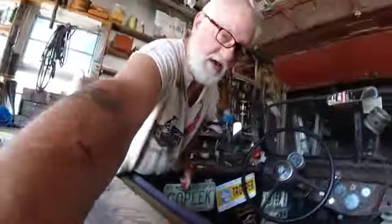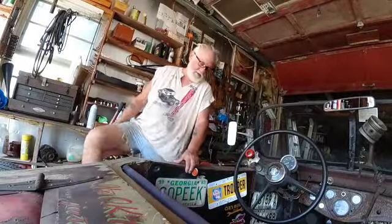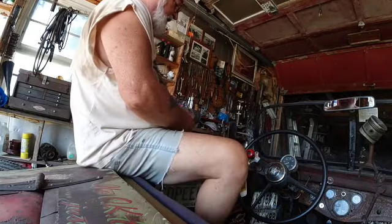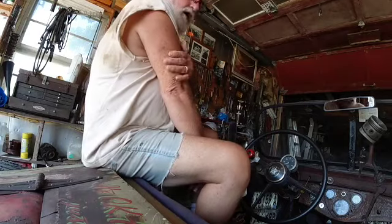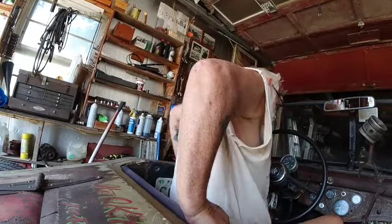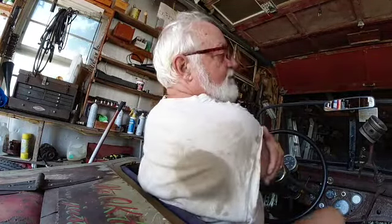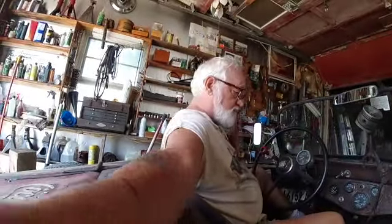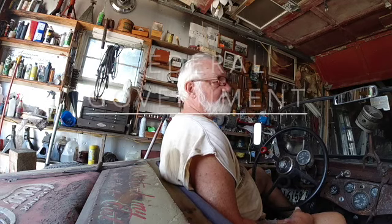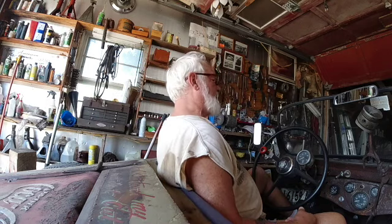Back in the 70s, they decided that we were all going to run out of gas, and they needed to figure out a way to slow us down, because in the age of muscle cars, moms were driving to the grocery store in GTXs and RTs and Camaros and all that. I think they thought if they made the cars where they wouldn't run fast, people wouldn't drive them as much, so it wouldn't be any fun. And there's a lot of truth in that. So what they did was they cupped out the pistons, chopped the compression ratio down from somewhere close to 10 to 1 down to something like 7 to 1. Took them from like 300-400 horsepower down to 145, stuff like that.